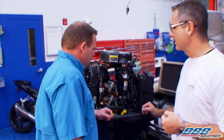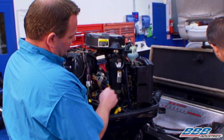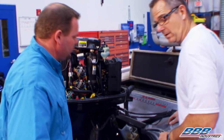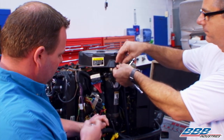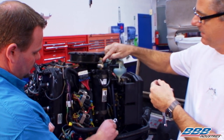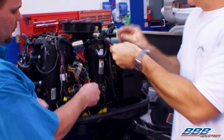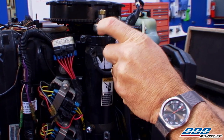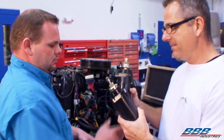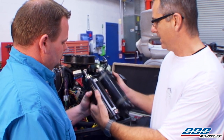Chase, tell them a little bit about how to do this starter motor replacement. Well, the first thing, John — disconnect the battery before we pull the big battery cable off. Then we've got two bolts on the bottom, two on the top, and we'll disconnect the power wire and the ground wire. Then we can pull the starter off and replace it. I got the battery cable off, you're safe. I'm going to pop that cover off the top. Moving the top cover makes it easier to get to the starter motor itself. Here's the pinion and the contact — the pinion's actually a little bit too close; we'll address that with the new starter. I'll go ahead and get these bolts. We've got a new starter motor right here — just match it up, make sure everything's good. We've got the ground wire and the positive — looks like a perfect match.